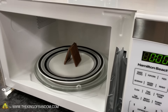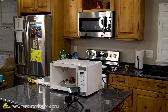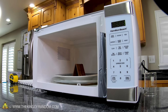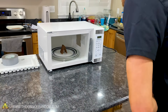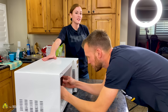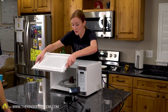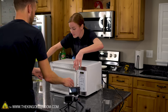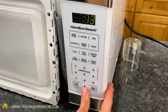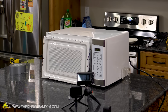Let's go for two minutes. Three, two, one. We appear to have an unbothered chocolate bar — the plate feels a tiny bit warm. So what we are doing is basically just dispersing microwaves into the room, not harming ourselves. Hold on — let's put the door mesh back in front of it, just leave it there, because I really do think the problem is the heat isn't bouncing around enough. Now while we did put the mesh back in place, it's still a severe leak for a microwave, so we are staying over here — we're never going to be near that microwave when it's on ever again.